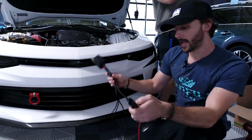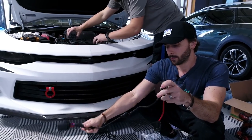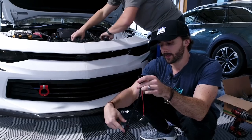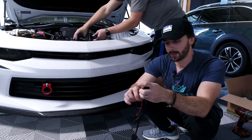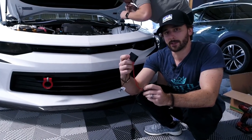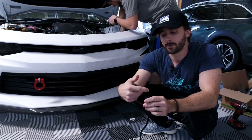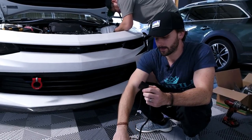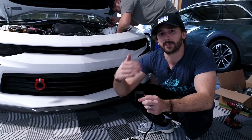This one actually has the anti-flicker capacitor link. It's already plugged in to the OEM input on the harness. What this thing does is go in between your factory wiring and the input to the harness — it comes from the factory output, goes into the harness, and it also has a ground, just one simple ground which is necessary for it to work. Inside the anti-flicker capacitor is basically a capacitor. It absorbs the current coming out of the factory wiring, which is pulsing on-off, and that prevents it from chattering or flickering the relays. It absorbs it and then releases it into the harness in a smooth fashion.